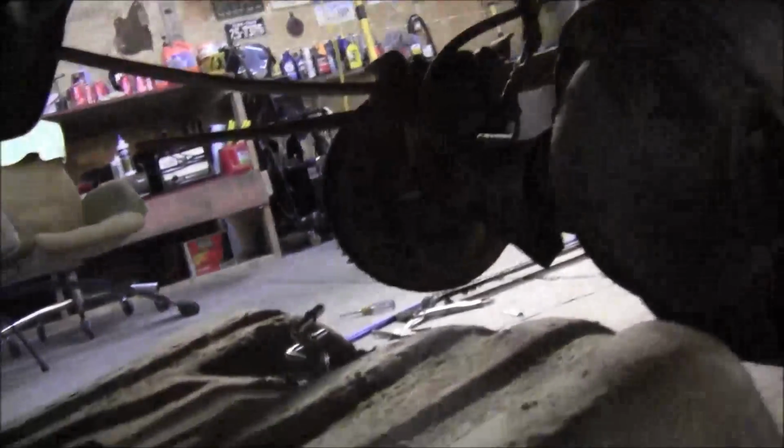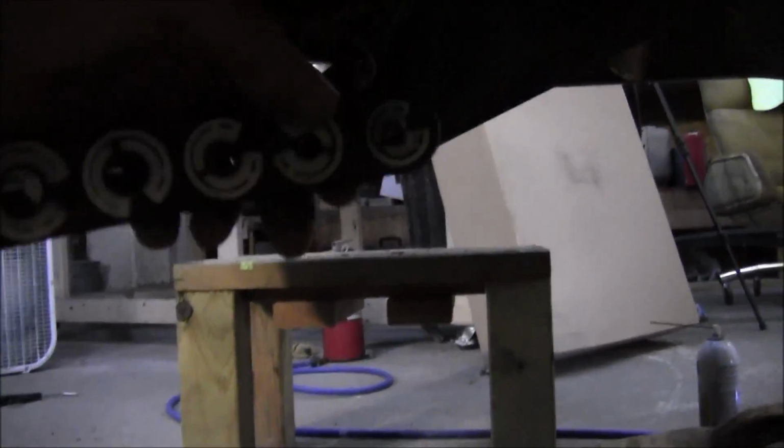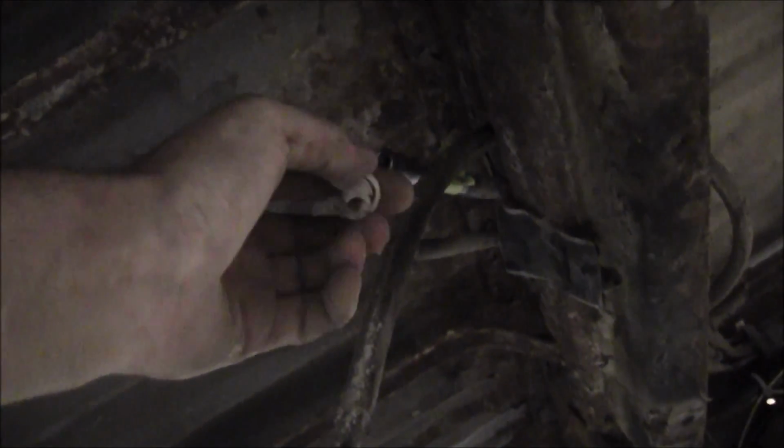It's these quick disconnects. If you don't know what I'm talking about, you have to get a tool. You go to the parts store, they look like this. I don't know what size it is, second smallest one. It goes in like that, and your fuel line is up in that. You snap this, it's open right there, and you snap it on your fuel line. Then you shove this up inside there. There's little fingers in there that it depresses, and then it's supposed to just slide off. They're called quick connect. They do connect real quick, but sometimes they're a pain to disconnect.